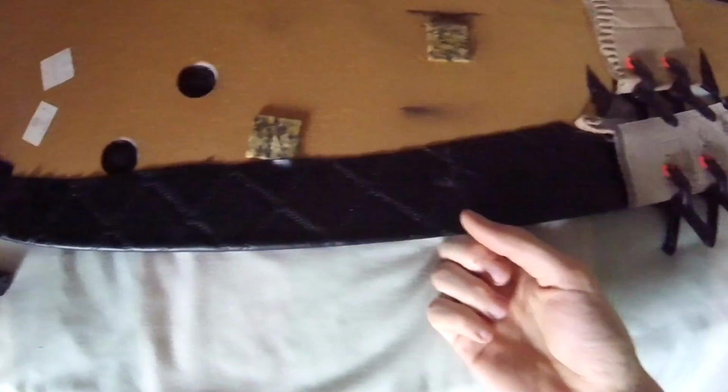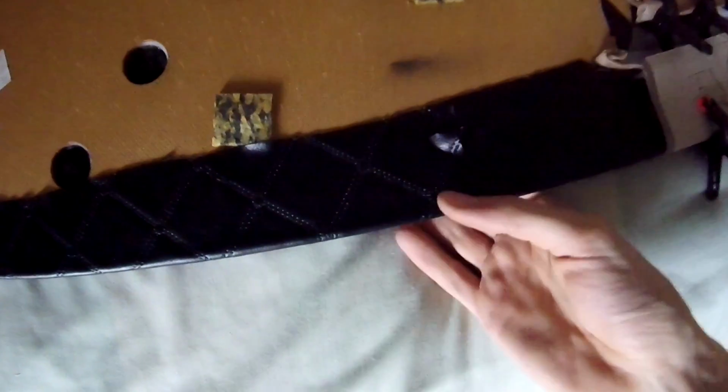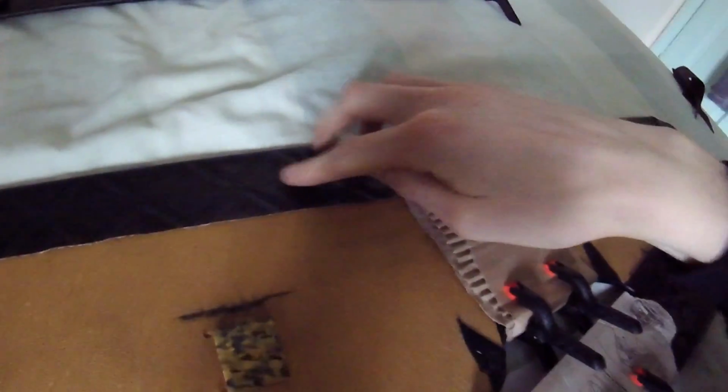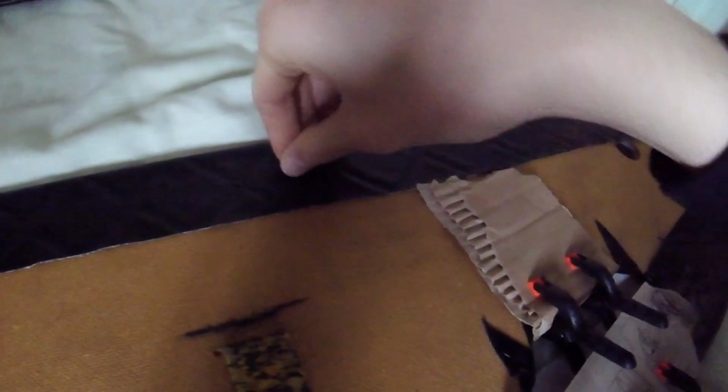Now, I have already put holes through for all the little bits that need to go through to hold the armrest on, obviously using the same method of cut it into pieces and then flap them around. We won't actually need to stick them down because the actual door rests themselves will push these through. But we've now got to find all the little holes for those plastic mushroom grips that we pulled out. So the easiest way to do it, basically feel for the holes, like I can feel one here, gently put the blade through, find it, gradually peel it open, and as long as the clip fits in, I'm happy.